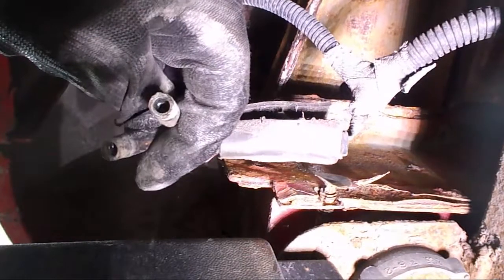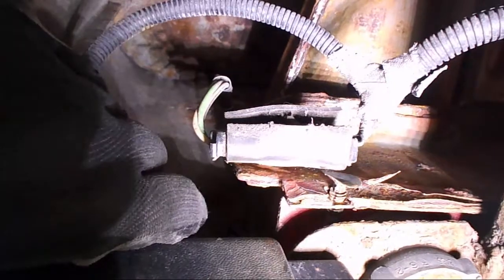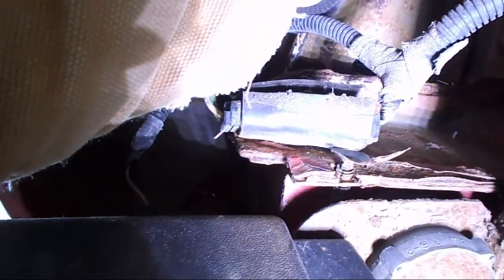Right away I found the two wires that go up to the contact pins, and when I reached up I could feel the pins. All I needed to do was push them in until I felt them click on. So that the pins wouldn't push themselves out, I just shut the tailgate to keep pressure on them.